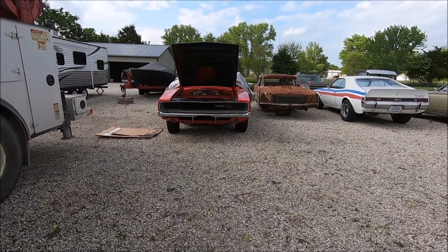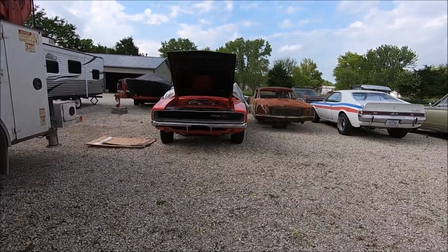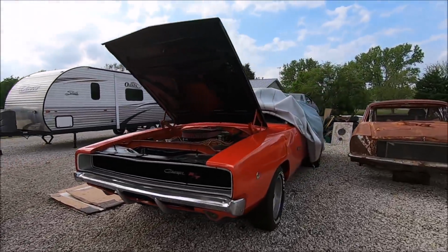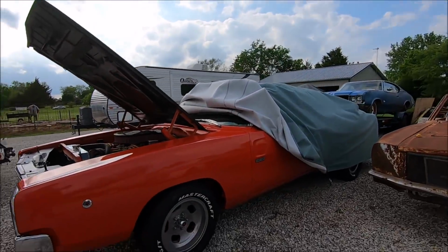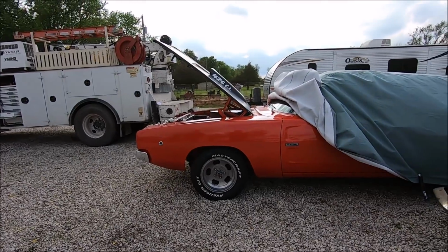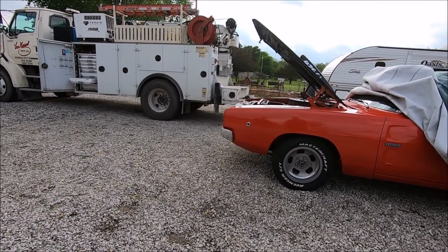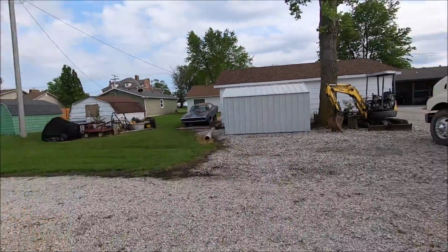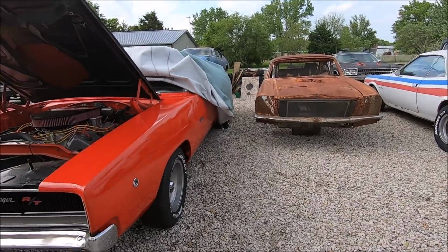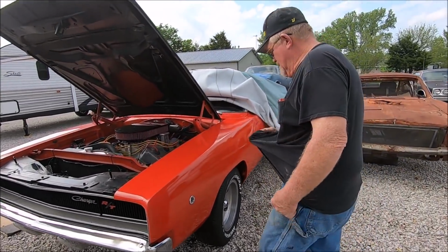I think your car's sitting a little high in the front, like a 4x4. Look how tall that's sitting. Well, I mean, it's probably driving. Yeah, we need a driver. A lot of people give me grief over Jezebel sitting nose in the weeds, but I don't know. Most cars need to have a little bit of rake to them. Yeah, maybe with them new bushings and stuff. Yeah, I think your bushings are playing a big part. Plus them torsion bar bolts are right in the same spot. Yeah, now there's no wear and everything.